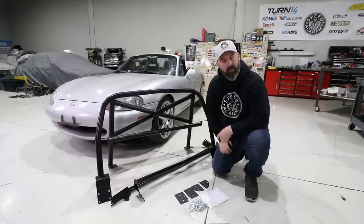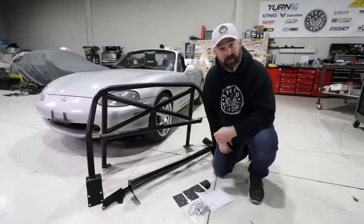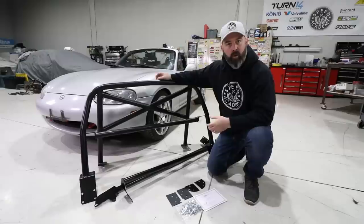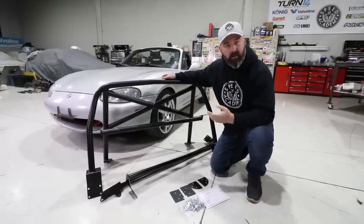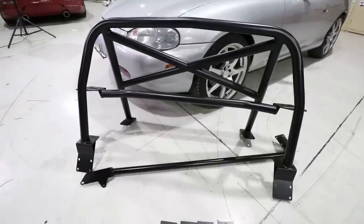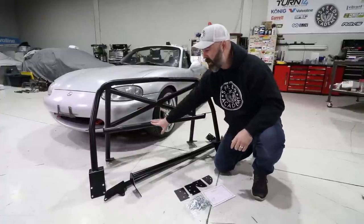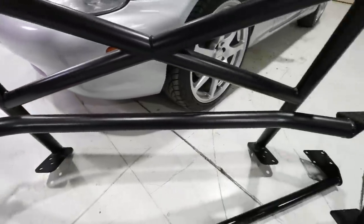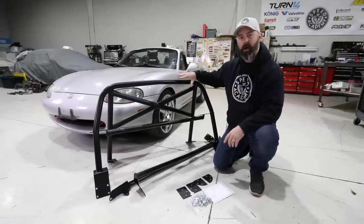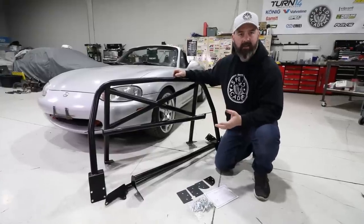When we first decided to build the Miata, we were looking at different options for safety, and it just so happened that the guys from Bafi Racing in the UK reached out to us and said they've got some interesting options for us in terms of roll bars. They sell a full line of roll bars from a company called GC Fabrications, also out of the UK, who make very nice looking roll bars. This is their GCR roll bar — the most race-oriented of their four-point solutions. It's got this big X-brace in the back, an integrated harness bar, and it does intrude a little bit more into the seating range of motion than their other bars which are designed to sit up on the top shelf. This is considered their strongest roll bar and we decided we wanted to go with the safest setup we possibly could.